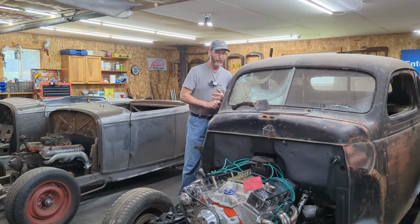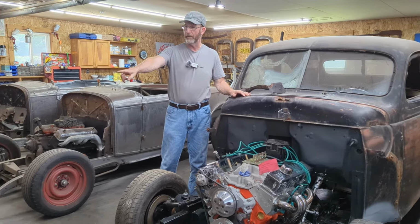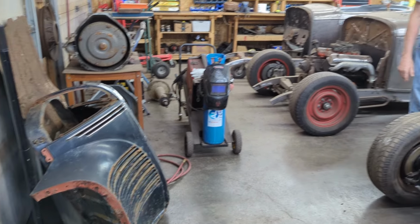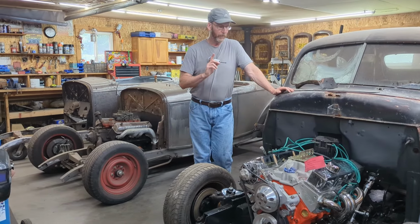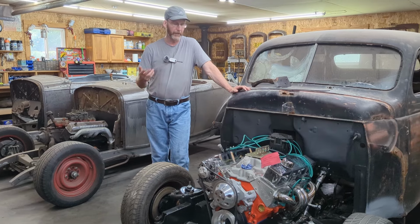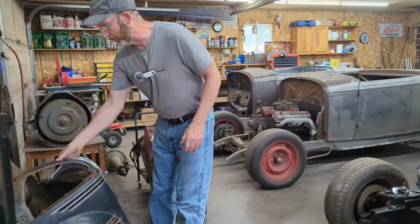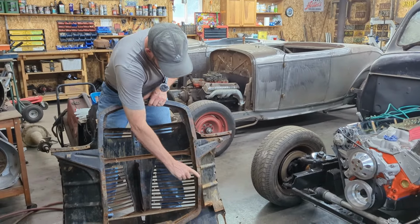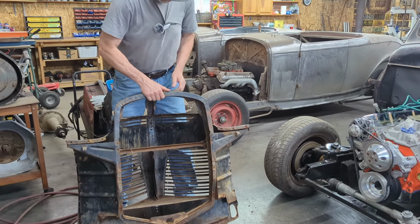So I'm going to have to hook up the emergency brake and the dash support, and then we're going to dummy on the front clip and the fenders. I've already made measurements. They are going to fit, but I'm going to bolt them in place and clean up all these threads here. For the radiator, we were thinking about using an aluminum radiator, trying to get an aftermarket one, and essentially making brackets up. The radiator would actually fit along here inside this cowl, so it sits quite a ways in.